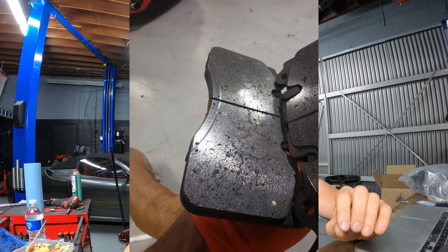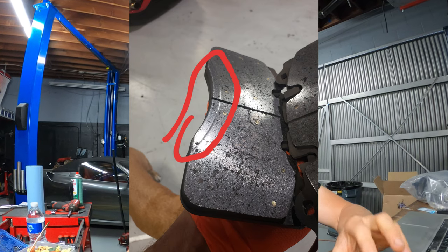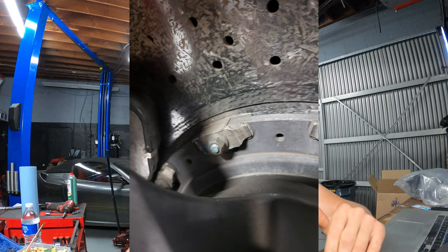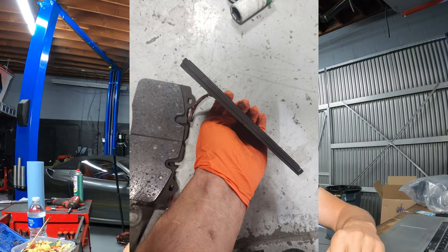If you look at these photos, this is where you can see that the bottom of the pad has a very thick groove that's developed in it. And this causes an unnatural wear pattern, also increased heat and a weird friction on the pad. It can cause fade or lock up on a wheel. It can also cause the rotor to be damaged and destroyed, which would be very scary, especially at high speed. It can cause imbalances in the rotor, but also if you look at the next photo here, it can cause the pad to bind and then twist, which can cause extreme damage or, again, a lack of your normal stopping power. So this is a poor design. I don't know why they would do that.